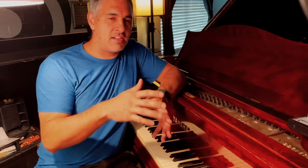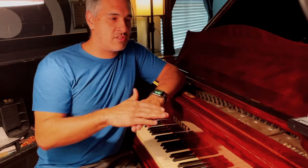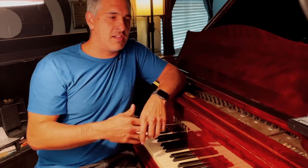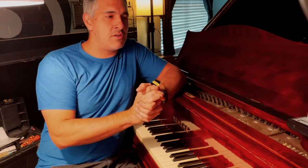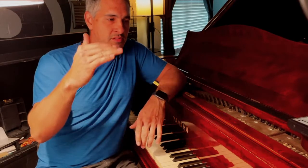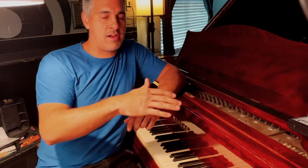But since I was going for the super glossy look, I did a nice scuffing on top of the sealer. It also helped me sand out some of the imperfections, because you can see some of that disappearing as you go. Then, when you're ready for your final coat, it's going to come out a lot nicer, and you can decide, do I want to do a nice sanding again and do a third round or not? So it's going to be the isolante sealer, then you're going to have the Polarion clear that goes over it. And that's the one that you could build if you want to. For me, I just did one round of each.